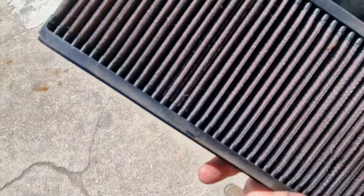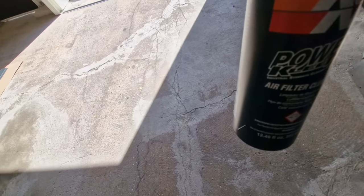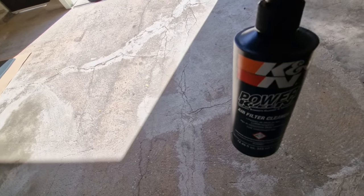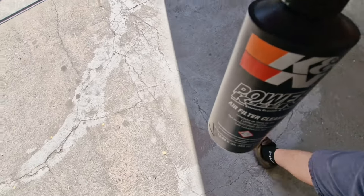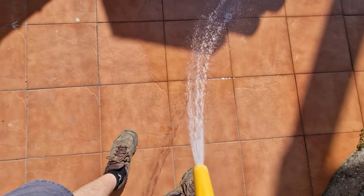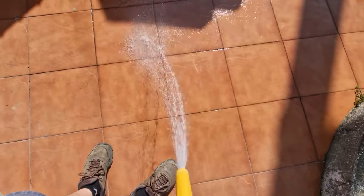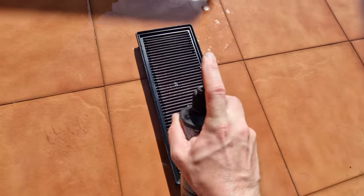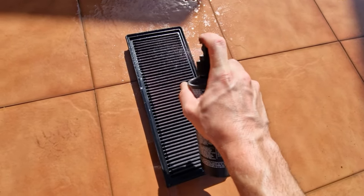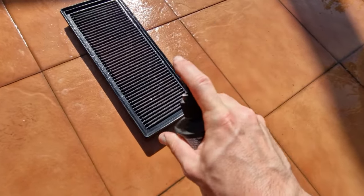Not bad - when the roads were under construction it was bad. Next step: clean the filter with this air filter cleaner. It's a kit that comes with the cleaner and the lubricant for the filter. I like to clean the floor and put the filter on a towel. Just spray all around - this is going to dissolve all the fat and dirt on the filter.